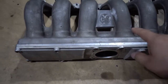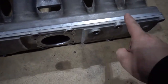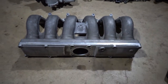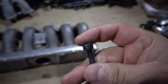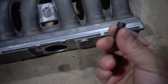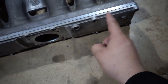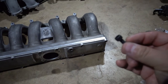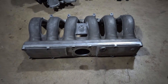I've been fighting this thing trying to get it dry after soaking it — spraying it with brake cleaner and blowing it with air — but I think it's finally dry. I was able to find some bolts at Home Depot; they're basically the same as the originals but in black. I think Lowe's has zinc-plated ones which would look even better, so I'll go there tomorrow and get those. Right now I'm going to throw this in the sandblaster, blast it down, and get it prepped for tomorrow.